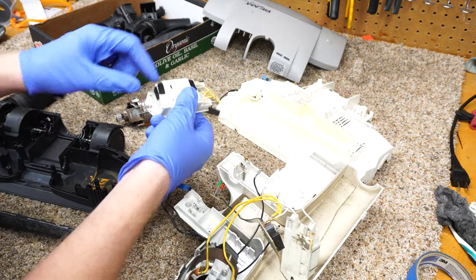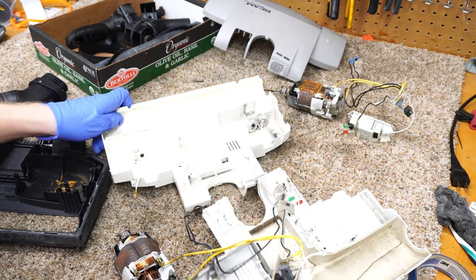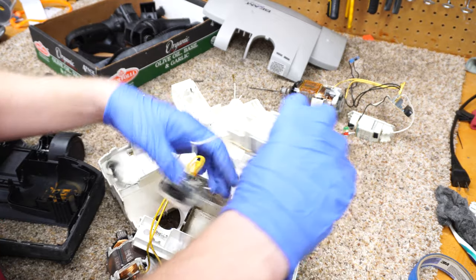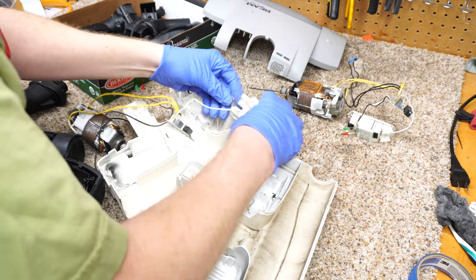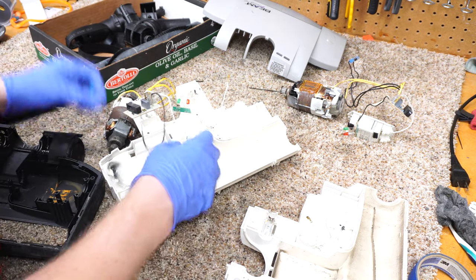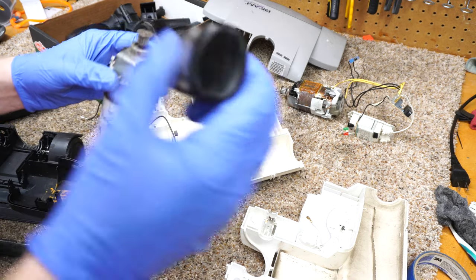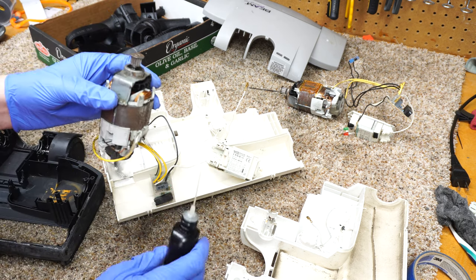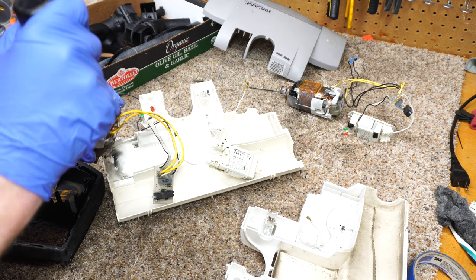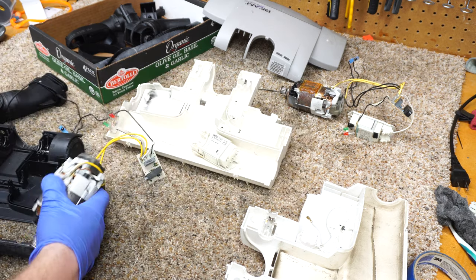Interesting — the felt pieces there. I'm actually going to transplant this assembly into there, in case anybody's wondering what the heck I'm doing here. The fluorescent light bulb assembly is actually really easy to transplant. Almost done. That goes somewhere on the board. We are going to give this just a little bit of oil — keep the grease in those bearings wet and pliable. That will free things up. Usually you don't put oil in ball bearings, but like I said, this stuff is pretty good for doing that purpose. That frees everything up — everything is much better with that.